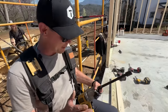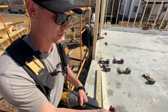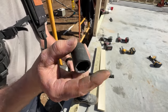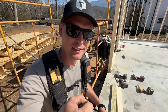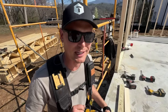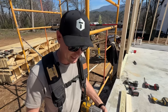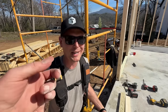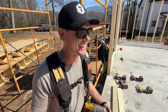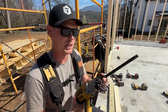We're driving these bolts with an impact wrench, and this thing is really powerful — powerful enough to destroy your socket set if you don't use the right type. The black-coated sockets are impact-rated. Your standard chrome sockets are not — they're meant for hand ratchets. We've been using a chrome one all day with the impact wrench. Someone's chrome socket ended up getting damaged — turns out it was mine. These impact wrenches are typically automotive tools — I use mine to change tires and brakes on my truck.